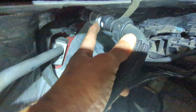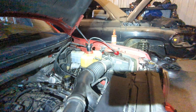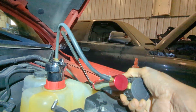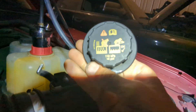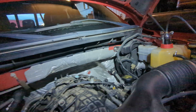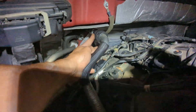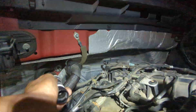This part swivels — you can test it while the vehicle is running. It needs to circulate and hold up a little bit of pressure, then you'll see it right there at the joint. This is a tool that allows you to pressurize your system — don't exceed the value on your cap. It was leaking here, and once I fixed that I saw it was also leaking on the other one, which is right here.